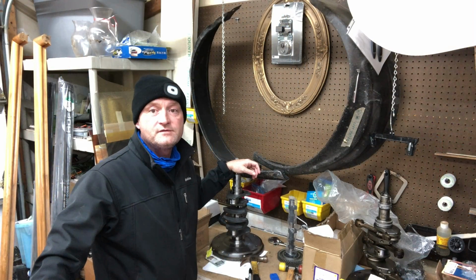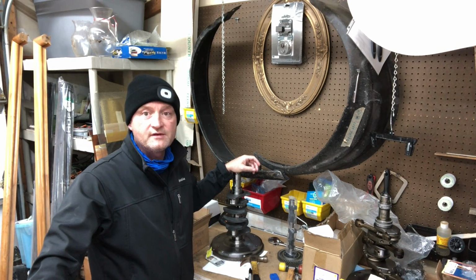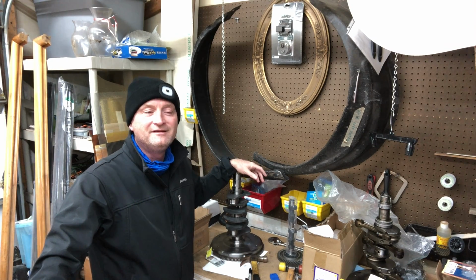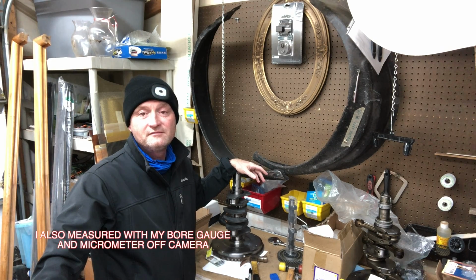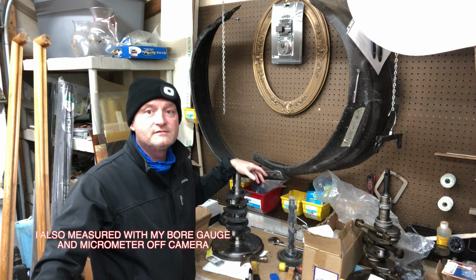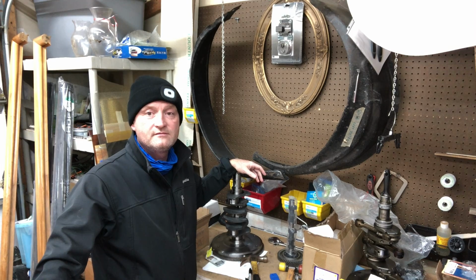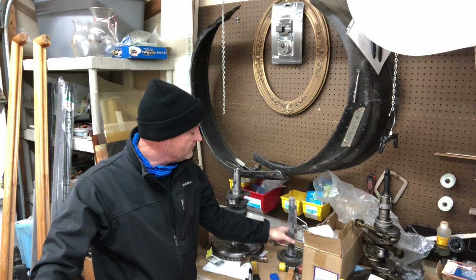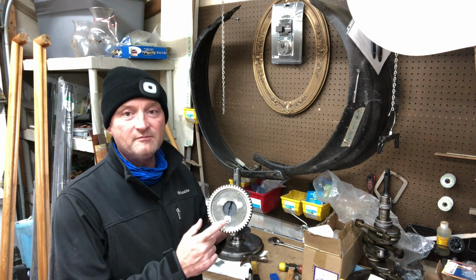All right. So I just got done checking my rod bearing clearances with the crankshaft, and they checked out at 2/1000ths, so that's good. Everything should check out right because everything is new, but you still gotta check it, so I did. I'm still waiting on other parts to actually put things together. I'm waiting on a new camshaft gear and really mainly the bolts.